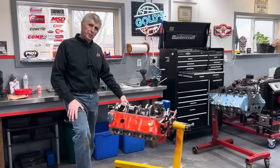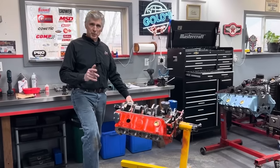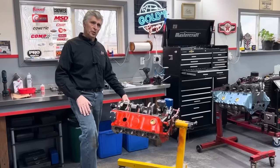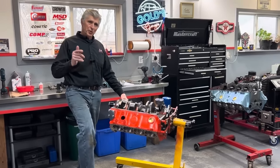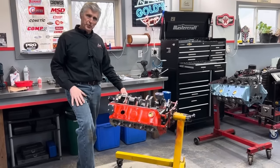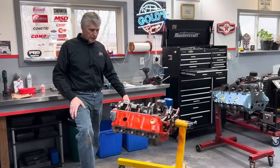It's not hard to build too much power — or in particular, too much torque. A 2,500-pound car coming out of the corner, probably only going 70 miles an hour with 500 foot-pounds of torque — if the driver puts his foot to the floor, it's going to go around in circles instead of straight ahead. So it's going to be tricky to drive and we have to keep that in mind.